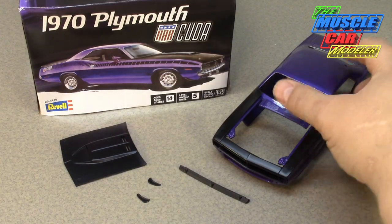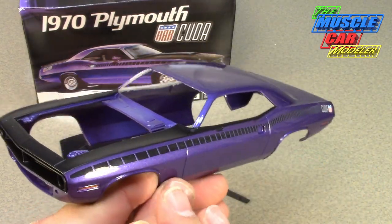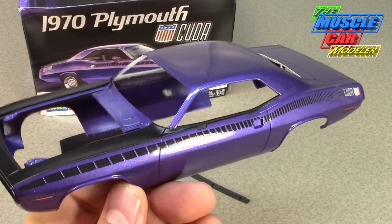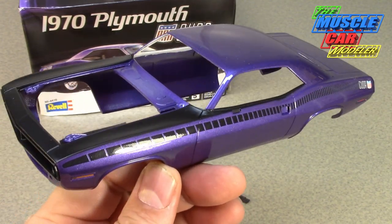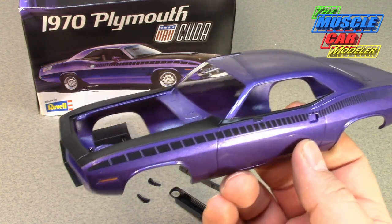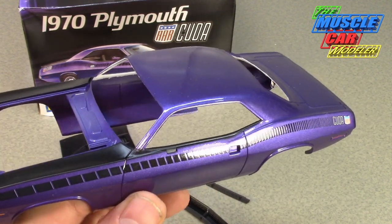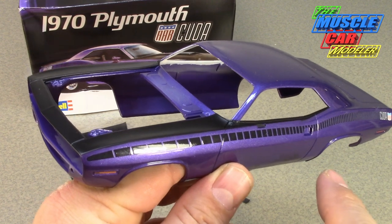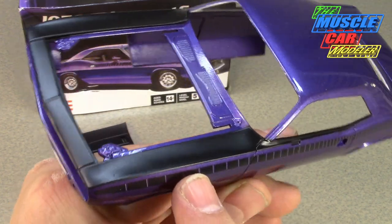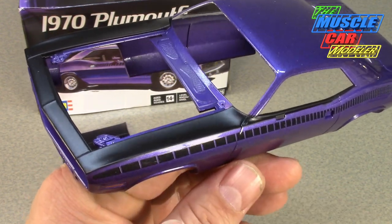I've given it a week to dry and this is the result. Some things that help this next step: I'm using real automotive clear coat and I've let it harden — it's actually been painted for over a month as far as the clear goes, so it should be pretty well cured. I popped the grill in just to see. The longer you have between coats the more it's cured, and the less the semi-gloss black will etch itself into the clear coat, but you can still polish it.